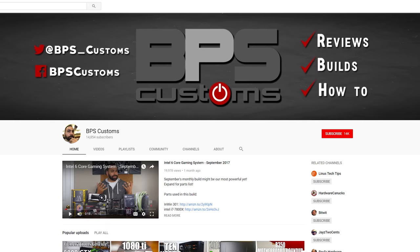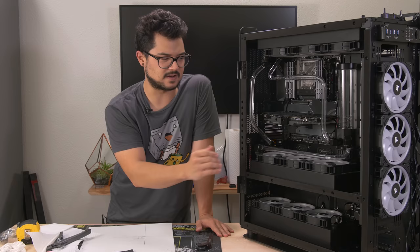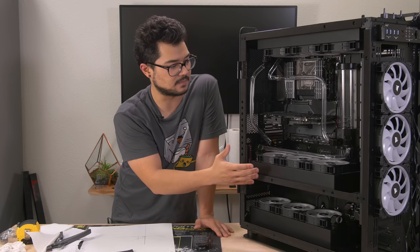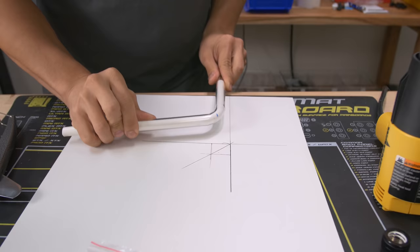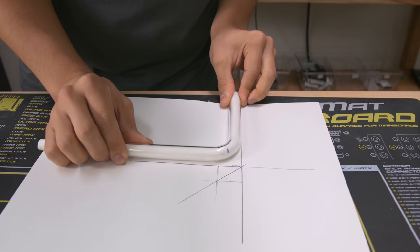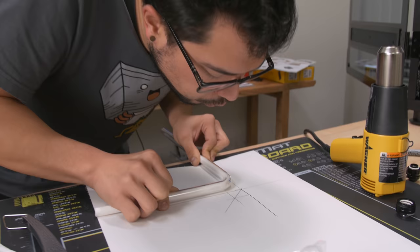Check his channel out, and thanks Brian for being a part of this video. Some of my own experiences: if you happen to cut a run almost too short so that it falls short of a particular fitting, what helped us a lot was actually sliding the radiators — maybe only a centimeter or two — but that keeps you from having to start a completely new run and wasting more materials and time. I also picked up an angling tool from XSPC, which would have been handy if it actually fit the tubing we were using. Instead, we improvised by drawing 90 and 45 degree lines on paper and angling the tubes that way, which worked just fine.